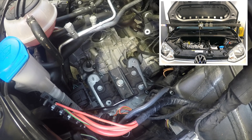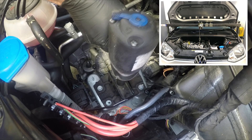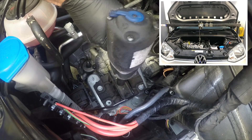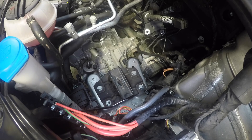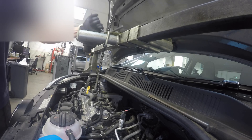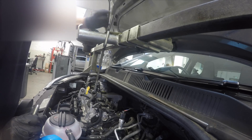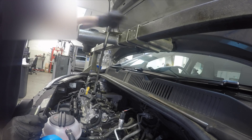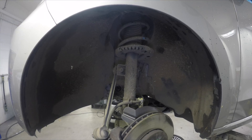From the top of the engine you can see I've placed an engine brace on top of the vehicle, just to support the engine as we undo the 18mm bolt for the gearbox mount. Then we're going to lower the gearbox ever so slightly — enough to clear the side of the vehicle but not so far that it hits the subframe underneath.